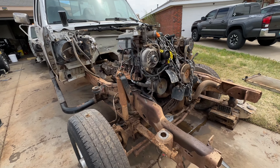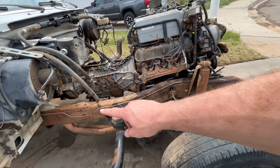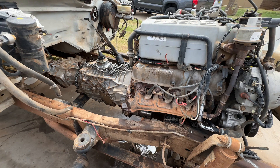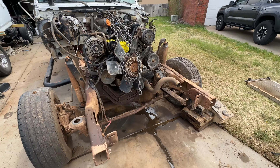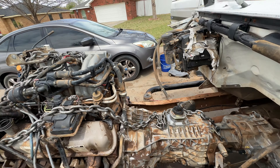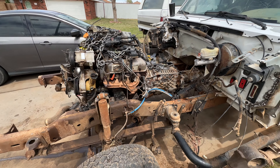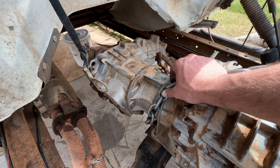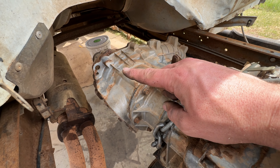Now that we got the cab moved back, we were able to pull this engine. I already got all the mount hardware out, and then I hooked up this chain. So now we just got to see if our lovely engine hoist will lift it, and if not then we'll have to separate them right here — it'll be easier now that the cab's not here, but it'll still be annoying. I originally mounted it around the rear of the transmission because I've had one of those little eyes break off before. But it looks like we're just twisting the transmission, so I'm just going to hook to that little eye hole and see if we fare better.